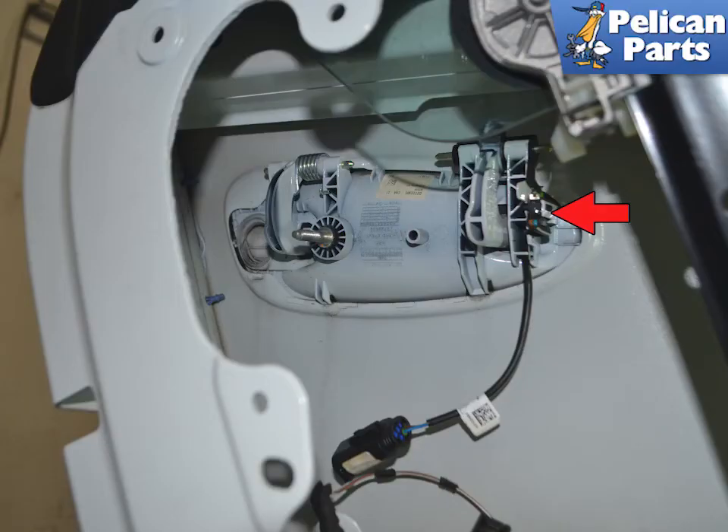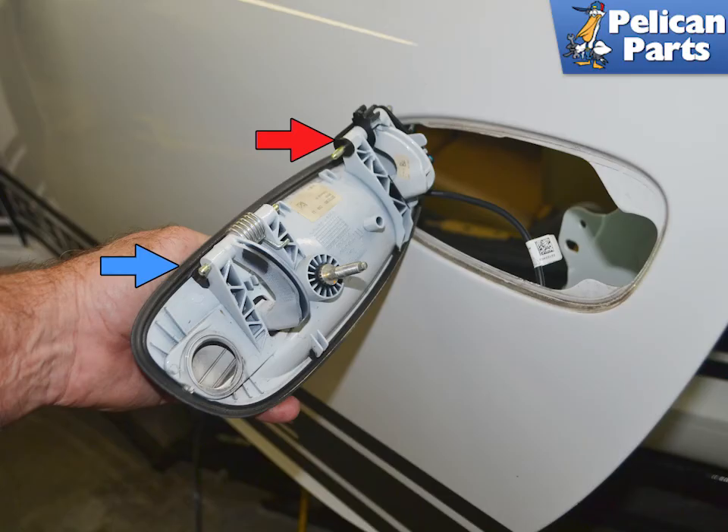The micro switch to lower the window when opening the door is located on the end of the handle, indicated by the red arrow. While some people have replaced the switch with the handle still in the vehicle, I removed it — it gives you more room to work and a chance to clean and replace the handle gasket. To remove the handle assembly, use your trim removal tool and carefully pry it from the door. Start at the lock end as it must be free first to clear the micro switch end.